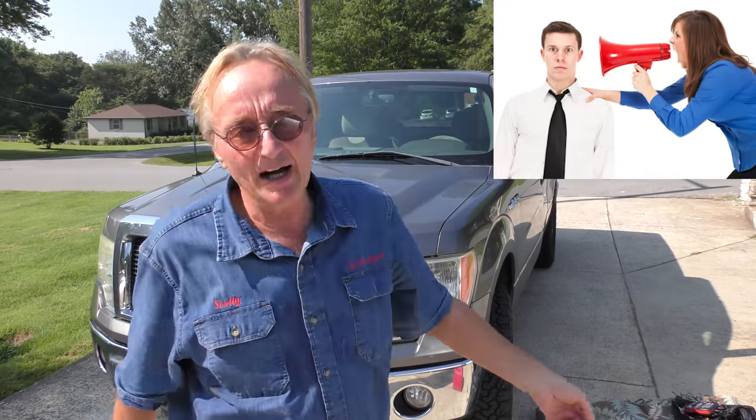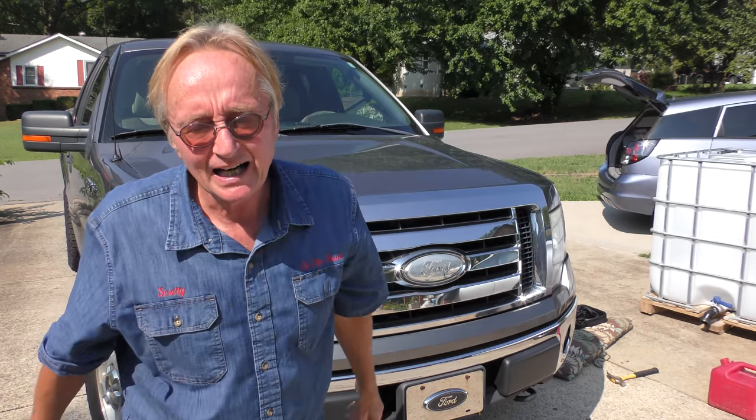He took it to a Ford dealer and they said they can't find out what's wrong. It took me 15 minutes to find out what was wrong. People don't even care these days when they work on your car — I do, and this is why I'm making these videos. Buy one of these $89 sound detectors — you can find any noise, six channels. You can put six clamps all over if you're not sure where the noise is, to pinpoint it. If you do go to a mechanic, plug it onto the one that made the noise — they can't argue when they hear and see the lights flashing. Like I said it took me 15 minutes; a Ford dealer said they don't hear anything. Anything can be done by yourself with a little tool like that — it also works on houses for pipe noises. You can make a logical choice and not waste money guessing on where a noise is coming from.